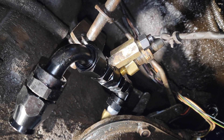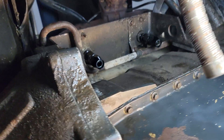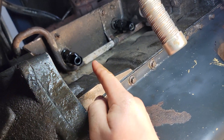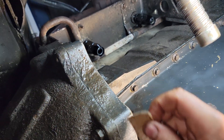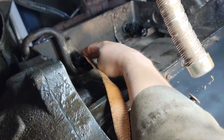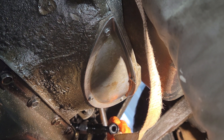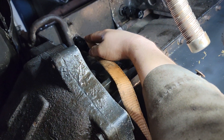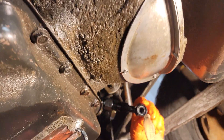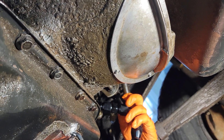We have the fittings mocked up dry right now. Here's the front one with both sensors in there, and we have the fittings mocked up on the fluid-to-fluid coupler. Now we just need to measure the length from the back of this fitting — we're going from the back on the fluid-to-fluid to the front on the transmission. We're using a strap to give us the rough measurement from where the hose would be, down under the inspection plate and then to that fitting. We'll pull this fitting and the 90 off and do our connections on the workbench, then come back and install it on the transmission.